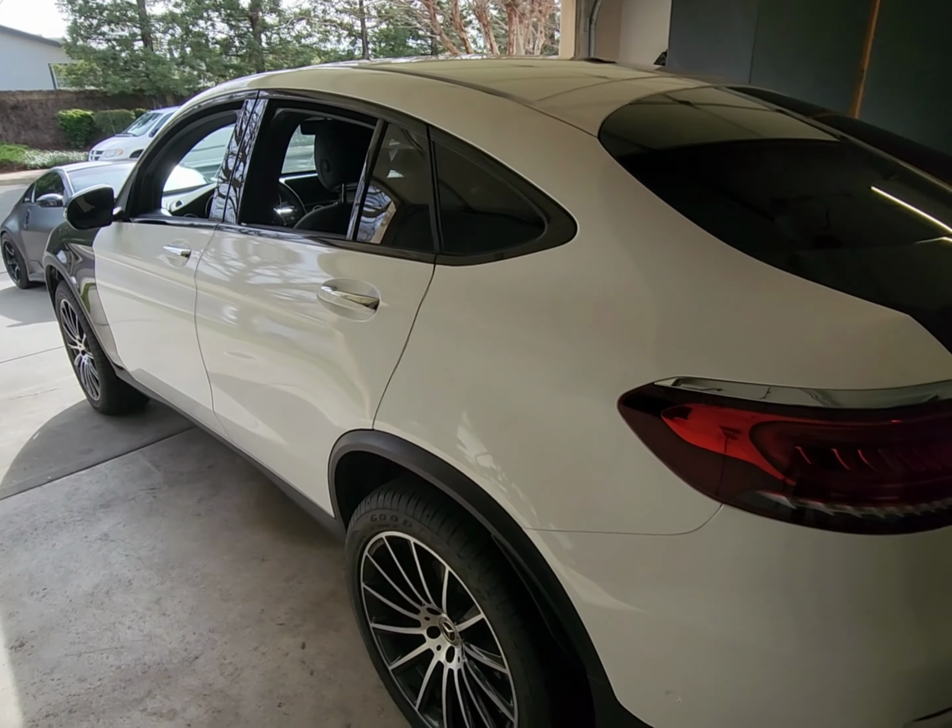Maybe you guys see my previous videos where I was wrapping a hood in gloss black by 3M 2080, or maybe a roof, and I was removing this protective film. Cool thing with 3M, this protective film doesn't need to be removed upon installation. You could easily wrap the car, then remove the film, and it'll get rid of all the scratches. I'll show you here in a bit with gloss white now. So definitely recommend 3M 2080 when it comes to chrome deletes, because that protective film gets rid of all the scratches left from the glove or the squeegee.